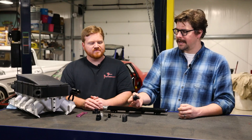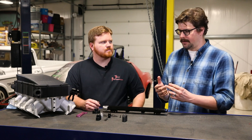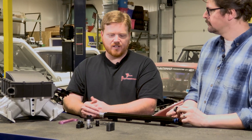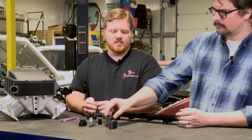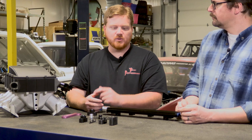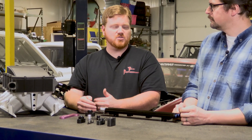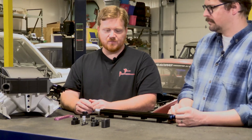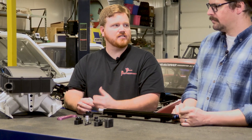There was a lot of emphasis made into how compact we can make this while keeping up with the flow. Yeah, that was the biggest challenge. You can see the first design — it was longer. The reason for that was flow characteristics; that's where we started to see how much liquid you could actually move through the fitting. So I started experimenting with making it shorter and shorter, and what you don't see here is there were about three revisions between the two until we finally got to a size where I was comfortable with the length.